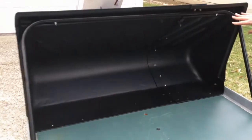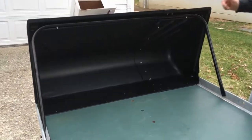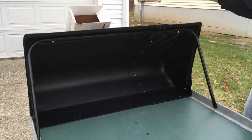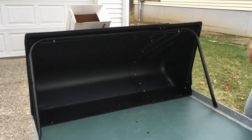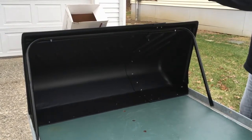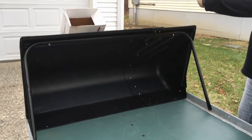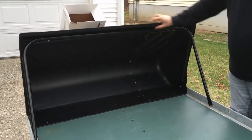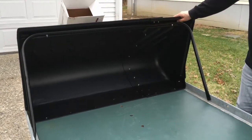These pipes are also oversized — they're intended for a double-wide trailer. They also come with three pieces: two outer curved pieces and an inner sleeve that goes on the outside of those two inner pipes. I also had to trim those down, and I cut about 23 inches off both pipes so they would meet in the middle, and then I put the outer pipe over them and screwed them to the top of the shield.